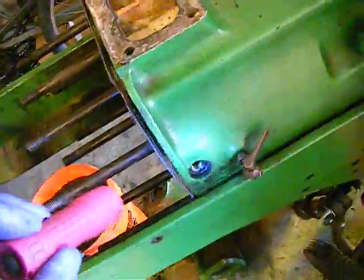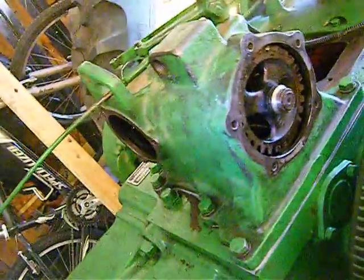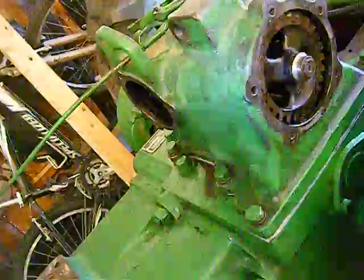After I put my cover on and put it all together, put my spark plug wires in there, turn it over, put a spark plug in it and see if when it comes to TDC it snaps. If that's correct, then it's firing correctly, and it should be because we have everything lined up.